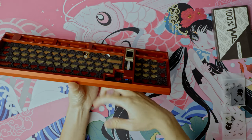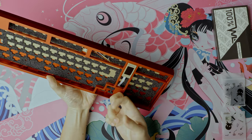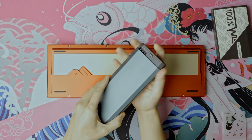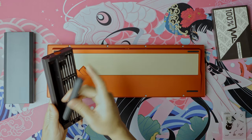As you can hear, this case is quite dead inside, just like me. There is no pinging whatsoever. To apply the rubber feet on the keyboard, we just peel them off and stick them in the cutouts on the back. And to take the thing apart, we simply unscrew the 8 screws with a H1.5 bit.